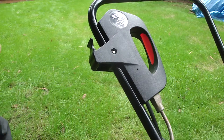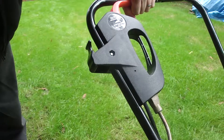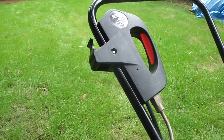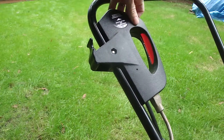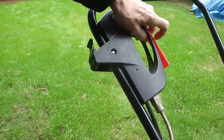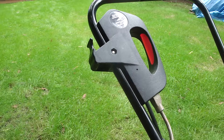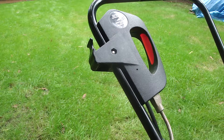I already made the repair but I can show you how to fix it. This is the switch. It's full power all the time now. I knew it was the switch because when I was operating it before the repair, when I jiggled the switch slightly, it would cause it to go back to full power from half power or being totally off. There's not many moving parts on these electric motors — there's a motor, there's a switch, and there's a cord, and that's about it. I'm sure other manufacturers are designed in the same exact manner.